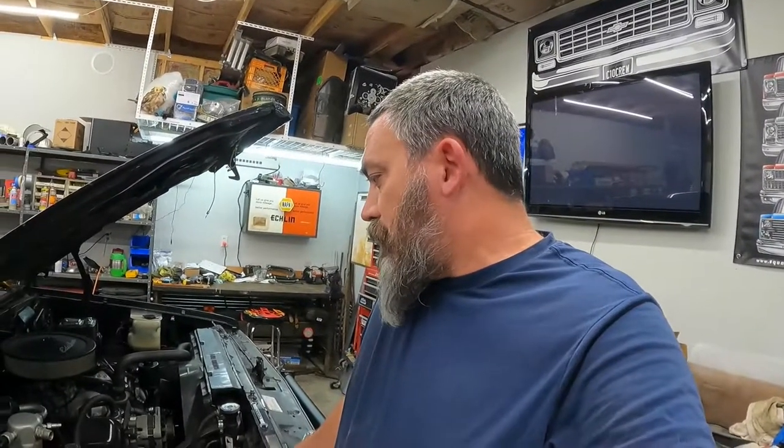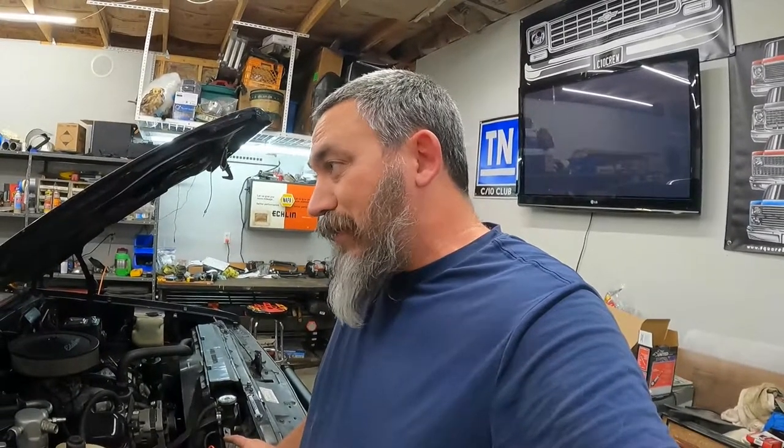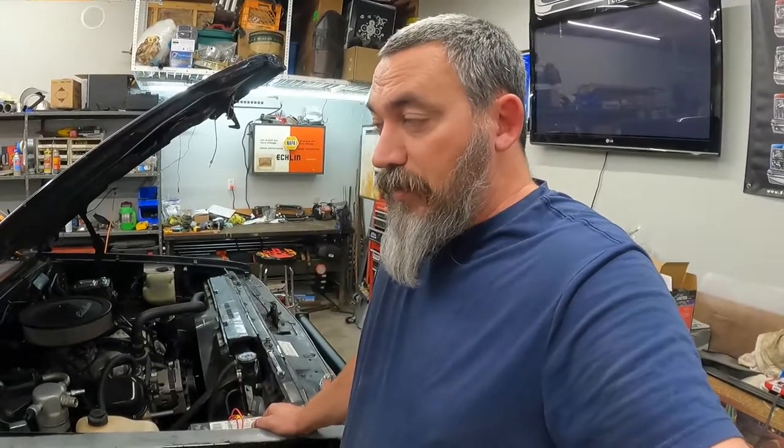So what I will probably do, if I feel like it later, I'll probably come back out here. I've got a driveline vibration issue that I need to solve. I don't think I have enough angle on the rear drive shaft, so I'm going to have to jack it up, loosen up the U-bolts, figure out what angle it's sitting at and reset it. I talked to a buddy that does these dualies a lot, and he said about 3 degrees is what he usually sets them at. So we'll see if that actually works. I don't know if it will. Honestly, I don't know what it's set to right now. So I'll have to get in there and get that changed up to maybe take care of some of the driveline vibrations I'm getting. I'm just worried because I had to replace that carrier bearing on this guy, and I really don't want to do that again. That's a pain in the butt. So I'll probably come back out here in just a little while and do that.